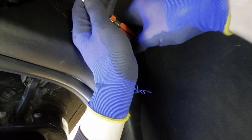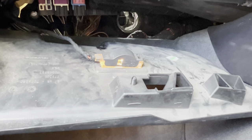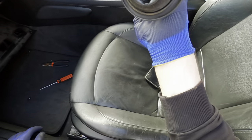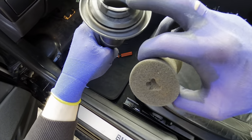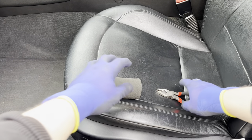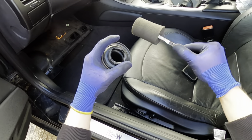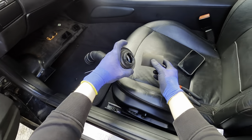Just go in here and screw it lefty-loosey. Both screws are now out and you expose the tray that drops down, exposing all the fuses and the interior light beneath. If you can see through there — I'll overlay some video — there is a circle which is the bulkhead, and this pokes through into that interior circle, exposing the foam. If your arms are long enough you can prize it out, but it is quite snugly fit in there, so get the pliers, pinch on it, and do a circular motion while pulling at the same time. It comes out with relative ease without ripping, because you're doing a circular motion rather than yanking it.